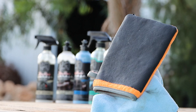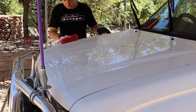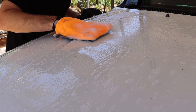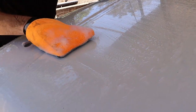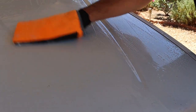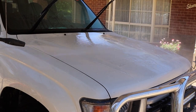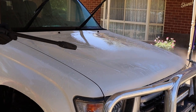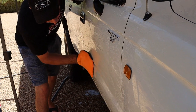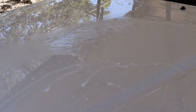Next on the list to help with the stripping stage was the clay mitt. No real need to prep the mitt like you would with a clay bar when you would mold it — just whip it out and make sure the surface you're about to work on is clean and well lubricated. I continued with soaping the surface, but this time to help lubricate the given area so the clay mitt could slide across and with it lifting the more embedded contaminants. I worked in straight motions again over every surface, giving more attention to areas that are more prone to getting dirtier or feel grippy or rough. Same as before, once I had finished a section it was thoroughly rinsed down. You don't necessarily have to use a soap with a clay mitt — it's been outlined that you can also use their quick detailer. The goal here was to get a surface feeling slick, looking clean and free of any protective layers. All these prep stages lead up into the next one, and taking your time with each one will help improve and in the end give you the best results.